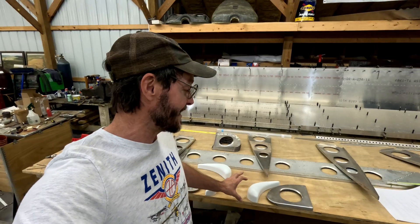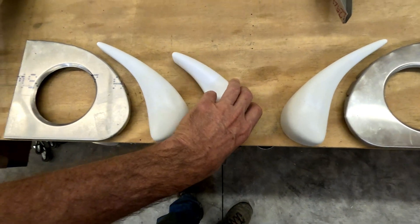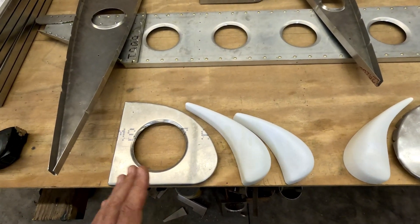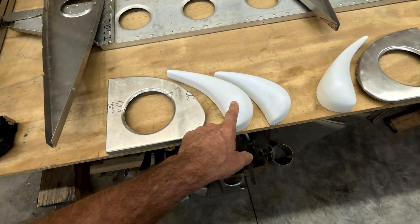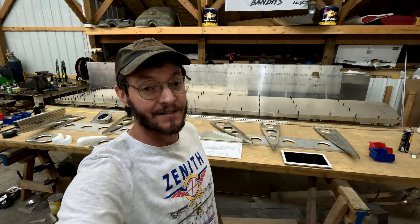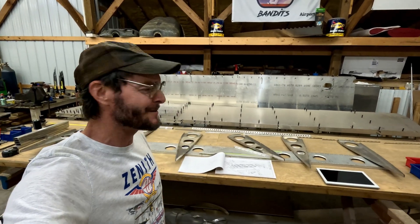A single slat that is set up correctly could be a big deal for this thing. In my mind I'm thinking I would be better off to go with the super duty slats. Of course I'll have to look at things like how thick the skin is, because I don't want to add a whole lot of weight going from the 701 slat to the super duty slat. But if I can get a good performance gain by doing so, I would do that in a heartbeat — maybe build a super duty slat with thinner skins that match the 701 type weight. Long story short, I'd like to talk to someone who has experience with slat studies, especially at the super low speeds I'm looking at. If you guys have any suggestions, please shoot them my way.